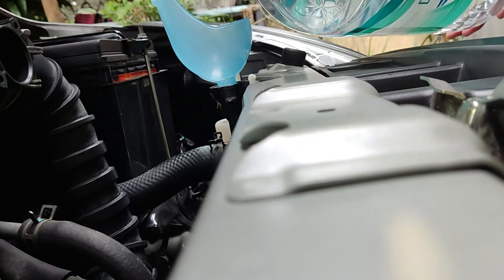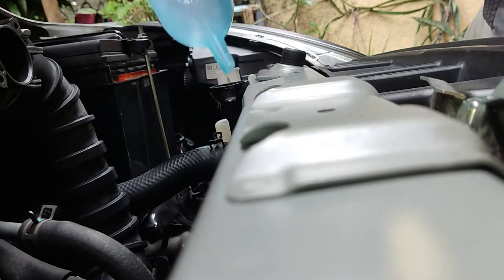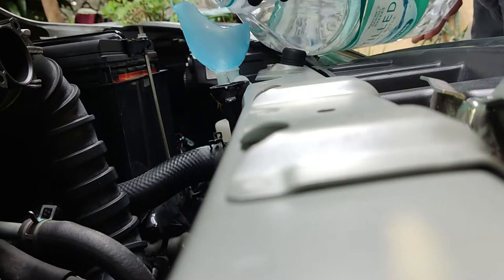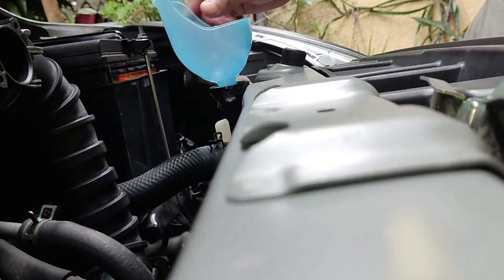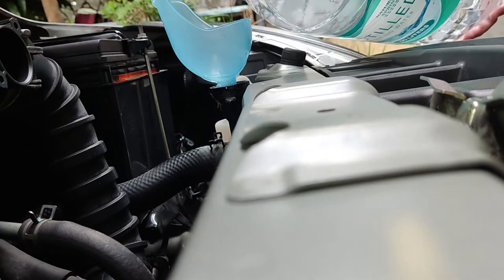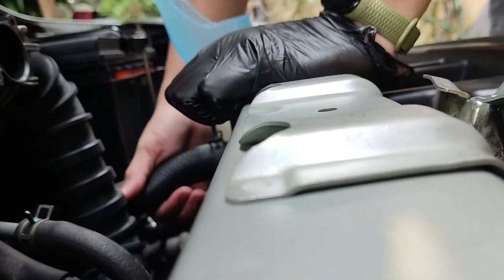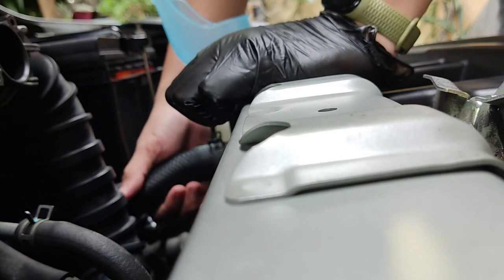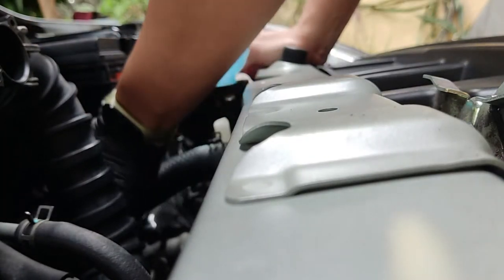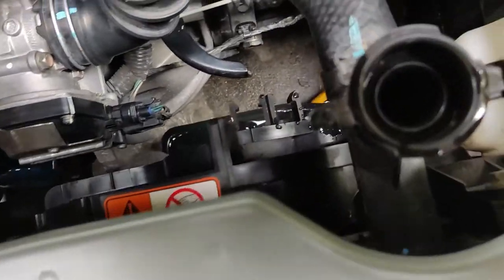Again, we use distilled water — not tap water from the faucet, because tap water can cause rust and corrosion that can damage or shorten the life of the radiator. When filling the coolant reservoir, don't fill it all the way — just to the minimum level for now, because it will fluctuate later. There are markers on the reservoir. We're also squeezing the inlet and outlet hoses a bit to release any trapped bubbles. Fewer bubbles — or better yet, no bubbles — means a more efficient cooling system.